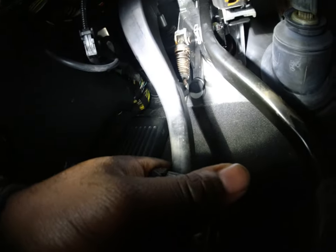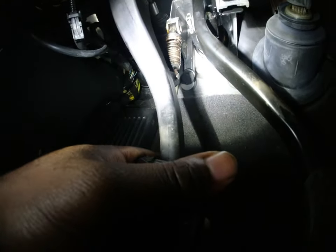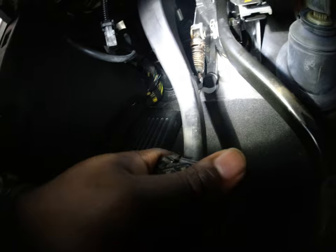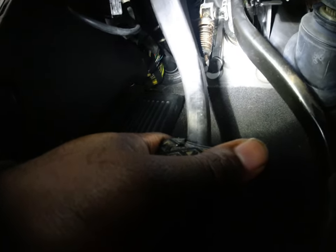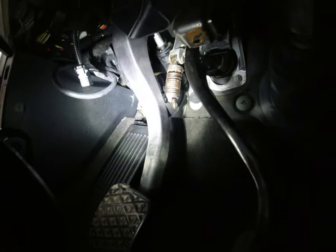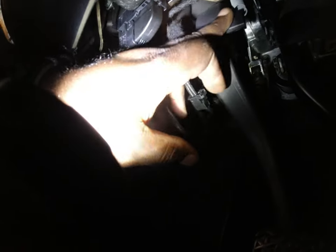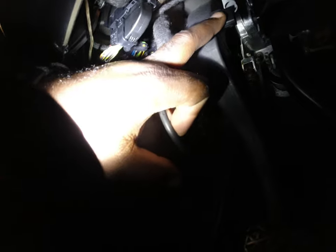So this is the clutch pedal I mentioned, and it is super tight in there. My best bet is to take it out first and then explain my way through. It's not really that hard, but there is a sequence. There's a spring right here I gotta take off and disconnect, and then there's a light-duty spring — just get a little pick or hook and remove it.